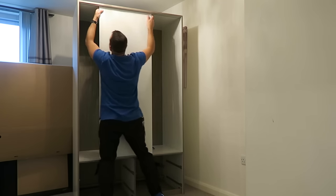Slide them in — if everything slides nicely and easily you did the right thing. This is the outer side, so place it in the front rail at the bottom. Slide it in nicely, press it in — one side then the other side at the same time — and press it into the plastic rail. Once you're in, push the lock up and it should lock in the rail so the door won't come out. Make sure you do this otherwise the door's going to come down on top of your head.